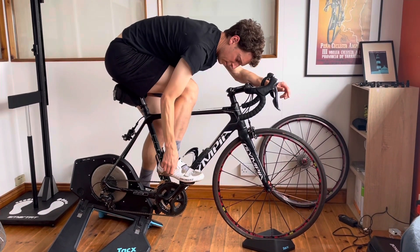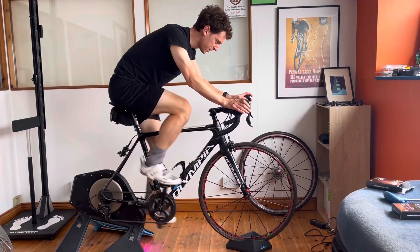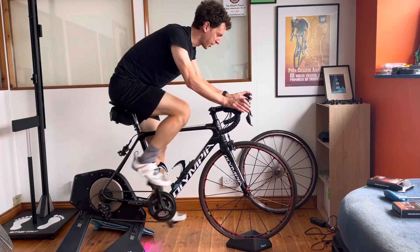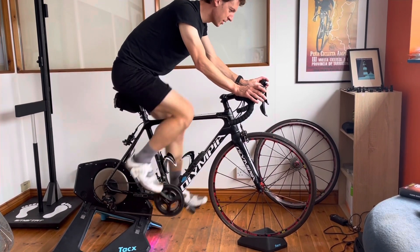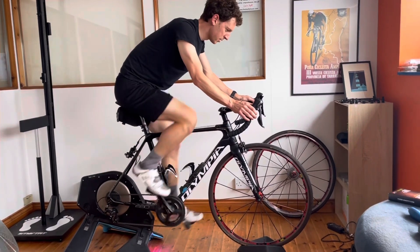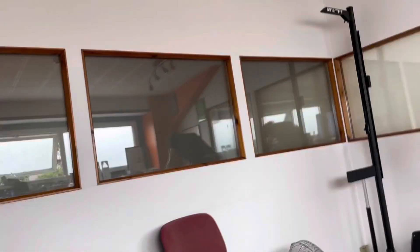With that feedback, I'm going to double the cleat wedge number to confirm whether a cleat wedge is viable. He's got two cleat wedges and one forefoot wedge. It just doesn't feel comfortable — my foot feels tilted, towards you. That would describe excessive cleat wedging because they'll feel like they're sliding away from the bike. So we're going to take those out.